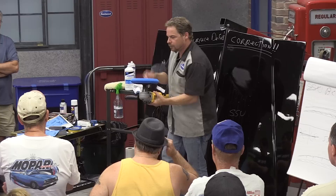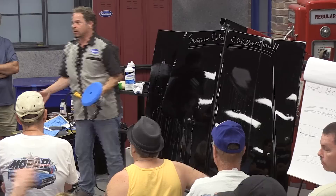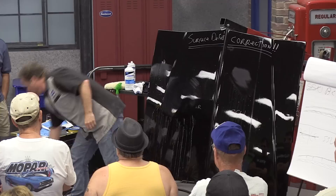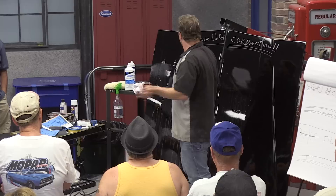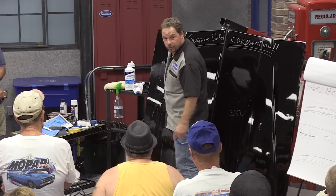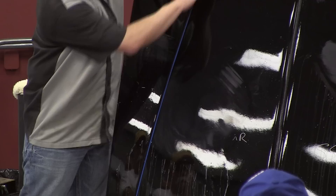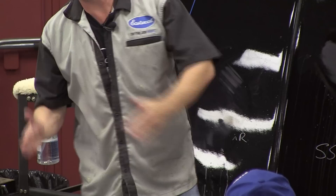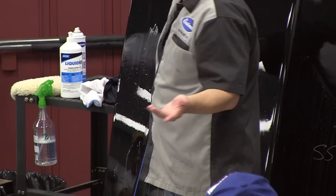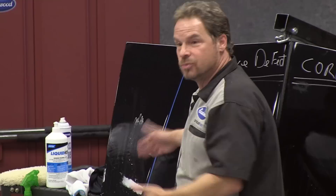Moving on to the blue pad, which is obviously more aggressive. A little pre-lube — everything's better with a little lube. The question was, if I'm doing an initial cut on a wool pad and I'm nervous about my edges and style lines — I don't want to roll that paint off — I use fine line tape. Sometimes I'll use masking tape if I don't have fine line. We've got a peaked edge here, so I'm taking my fine line, tacking it and stretching it. What I've done is covered that edge. At 1000-1500 RPM, if that buffer hits it, it's going to rub the tape right off — this is a reminder more than protection that I'm getting too close to that edge.